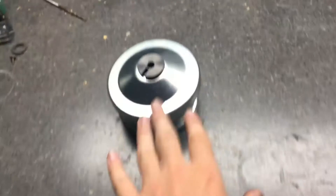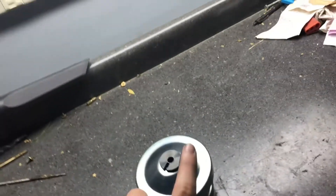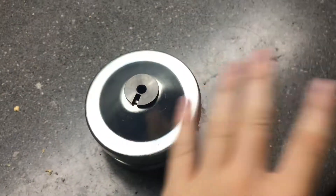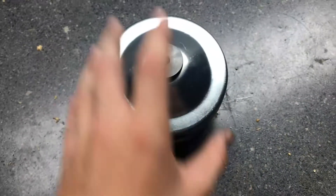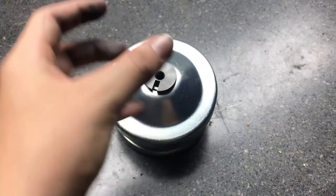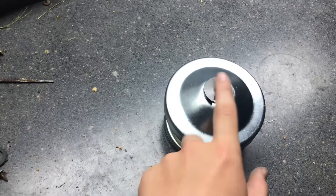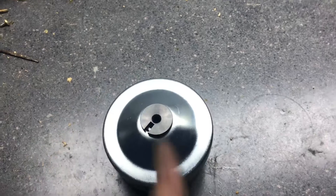And that is your 30 series torque converter clutch — that is the assembly. So I did the unboxing and I just decided to come out here and do the quick assembly for my 212. But remember guys, something that Go Power Sports does not mention: you guys have to take out the key first, and then this will all slide on. And if you're just ordering the clutch itself, make sure — because it won't come with a bolt — make sure you can find the right thread and the right size bolt to go in the tip of the shaft and bolt in right here.